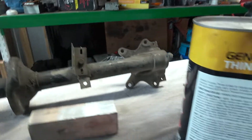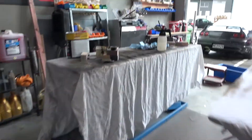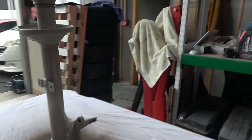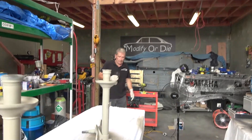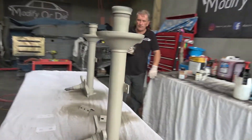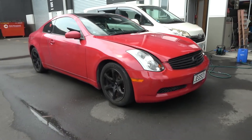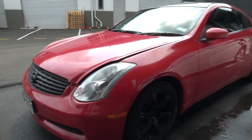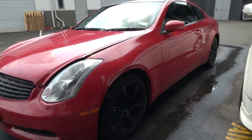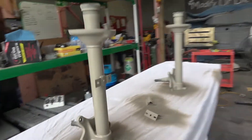Getting closer for the Bandeau to come out — we're not quite there yet. So one of the things today is the struts for the Beamer. These are the two front struts — they've been cleaned up with some primer on them, we'll get those flatted back and put a nice layer of 2K black on those, and they'll look mint. We're also going to pick up another car to sort out — it's got a scraped dent, smashed windscreen, the engine sounds nice but it's got a bit of a knock, so I'm going to pull it apart and inspect it.